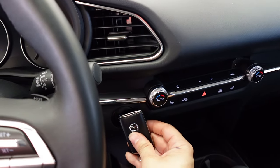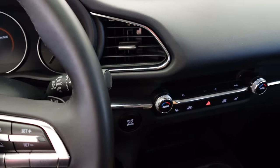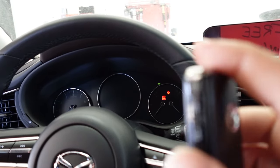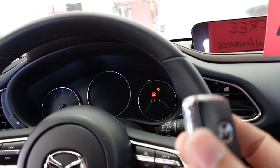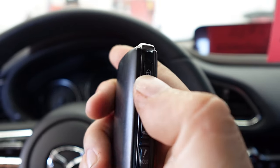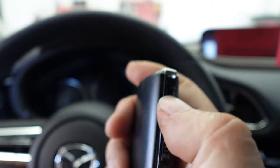As you can see it started up, but only by putting the key fob onto the start button. Sometimes this is actually mistaken — customers have come in and complained that their key fob doesn't work anymore, it doesn't open the door when they walk up to it, or they have to press it up to the button. Most of the time it's because the key fob either has a dead battery or it's in battery save mode.